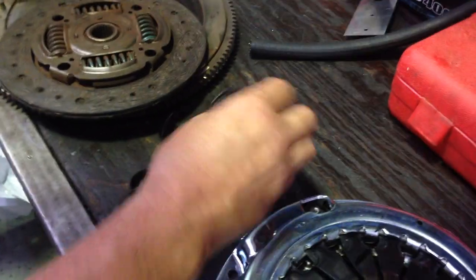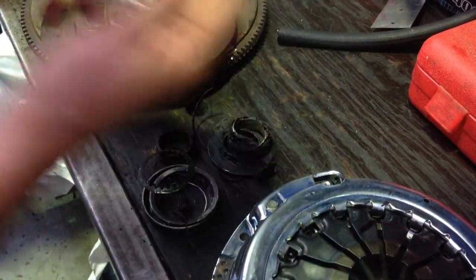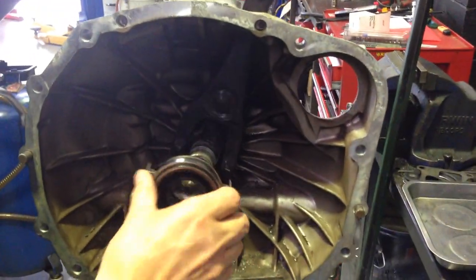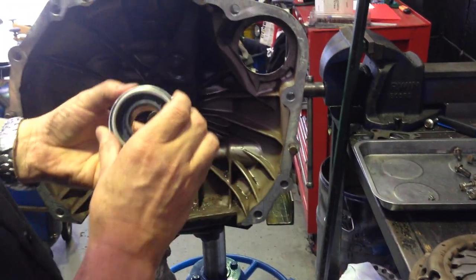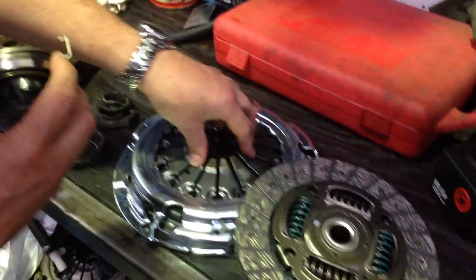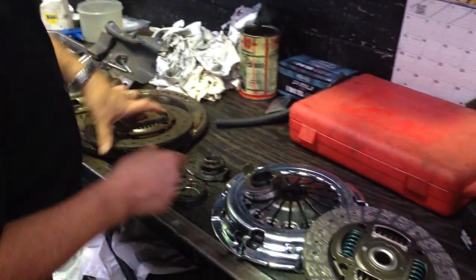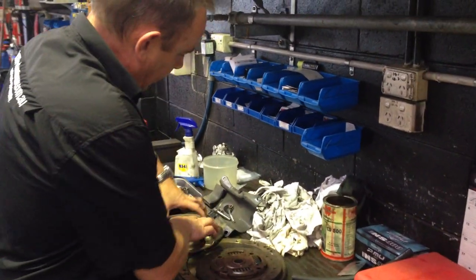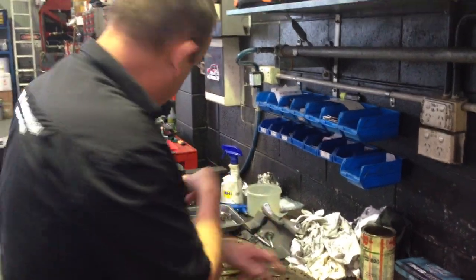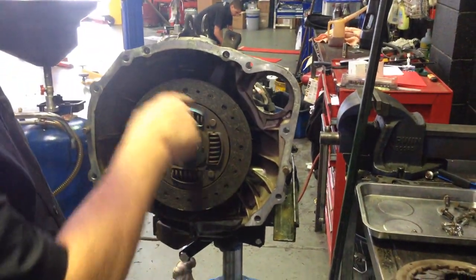This is what's left of the release bearing that is supposed to slide, and what it should look like is that particular part fits in behind the clutch fork and slides up and down on that assembly with a light amount of grease. That is what pushes on the fingers of the cover plate to disengage it from the driven plate of the clutch, which is the friction material that works on the flywheel. This part is connected to the crankshaft of the engine, and through the drive in the center it's connected to the input shaft on the gearbox, and when you put the gearbox together that connects the friction part of the flywheel and the cover plate to the engine.